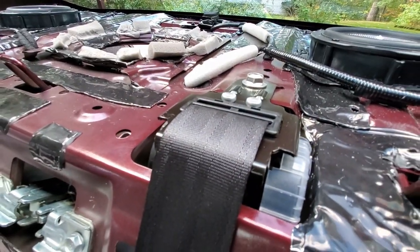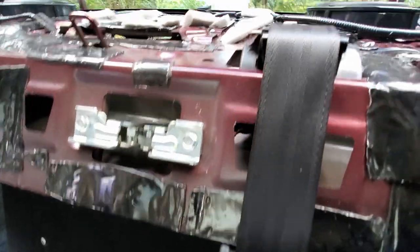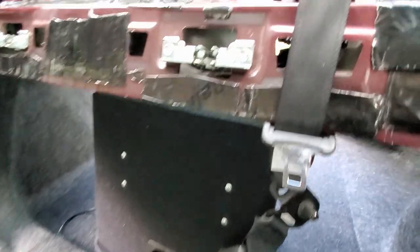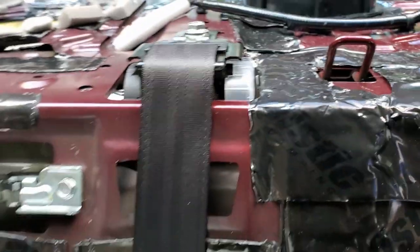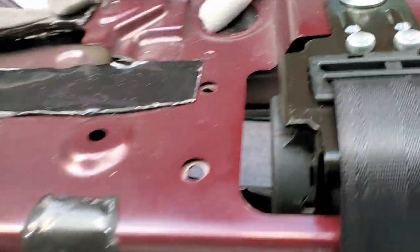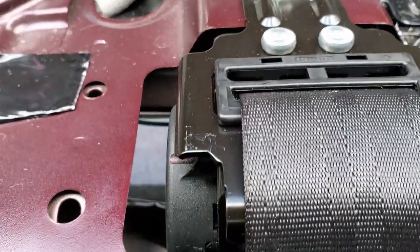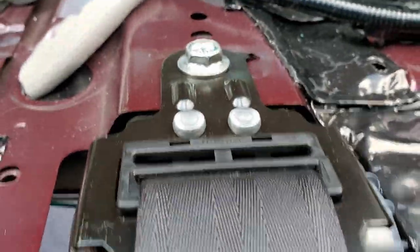Here's something very important — that's a seatbelt. Me and my friend broke that seatbelt. Here's something many of you may not know: if you undo the bolt at the top, the seatbelt will start rattling down and sucking itself down, and you can't get it back up without taking it apart and undoing the ball bearing. So you need to be very careful. If you want to undo this bolt, maybe stick some padding in there, you need to make sure you get yourself a good clip right there at the seatbelt so that when it comes undone, once you take it out, it doesn't start raveling down to the bottom. Otherwise you're going to have a heck of a time putting it back together. I had to get a new seatbelt because when we took it apart, we couldn't get it back together — there were tiny parts in there that broke off.